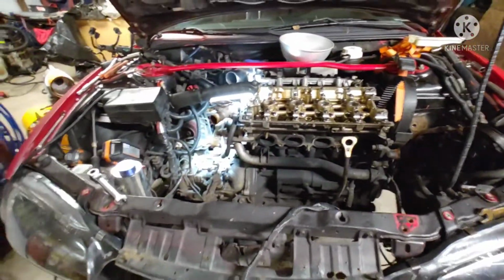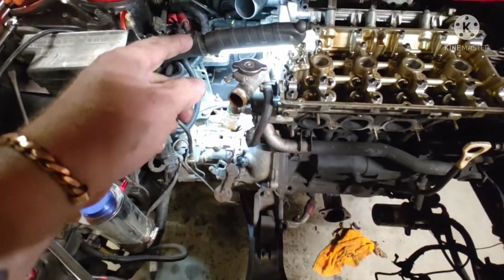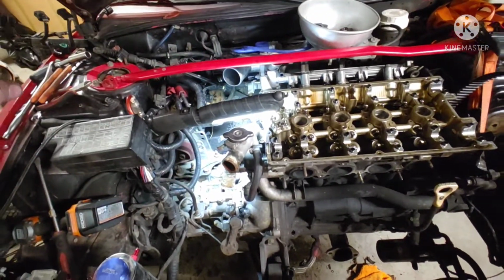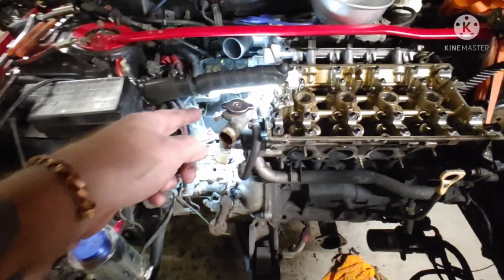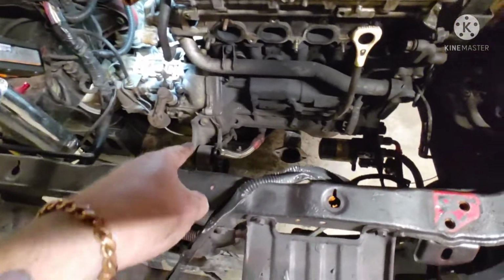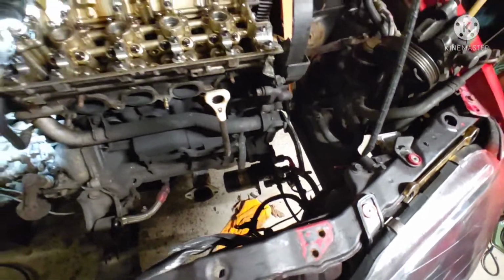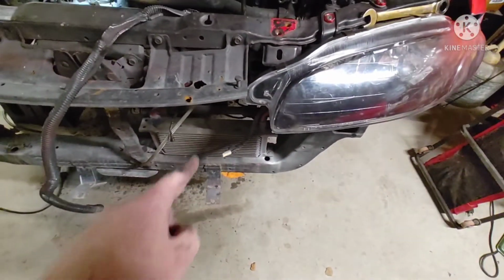All right, everybody, this is where we stop for the night. Should just be for the night, but tomorrow's Thanksgiving. Shift and linkage unhooked, fuel line unhooked. That top side wiring harness is done. I think there's a bottom side wiring harness, a couple of wires, and then a bunch of mounts. Hydraulic line right there. A couple of motor mounts, and the oil system over here. So what am I in? The oil cooler right here.